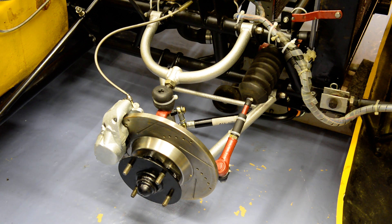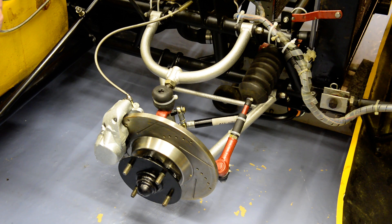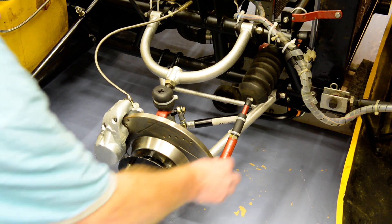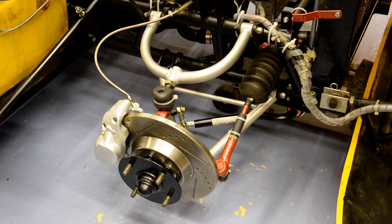Essentially, the items of setting that you can adjust here are the camber angle via the top ball joint, and the toe-in or toe-out via the steering arms. This is set with a very slight amount — probably 20 minutes of arc of toe-in. You'll see that I've covered the adjustment thread with rubber just to stop that corroding and keep the dirt out.